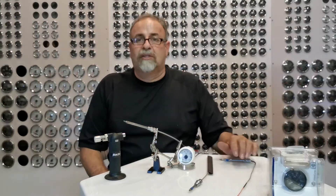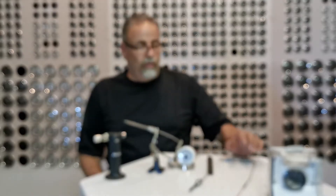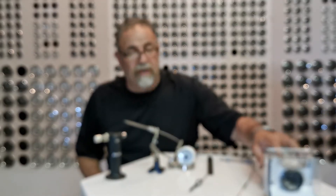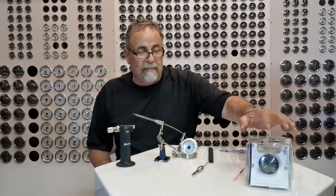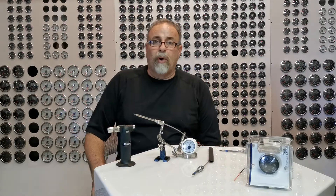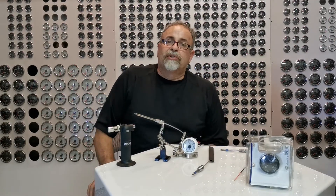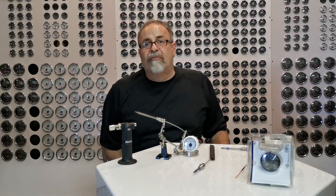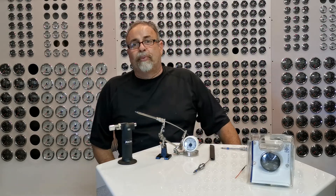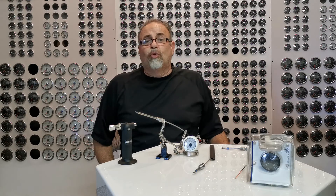That's what's called exhaust temperature. We are introducing exhaust temperature gauges from VDO — VDO Switzerland. They make these gauges which we call pyrometers. A pyrometer is a special gauge for measuring the actual exhaust temperature. So why the exhaust temperature? Why not the engine temperature?